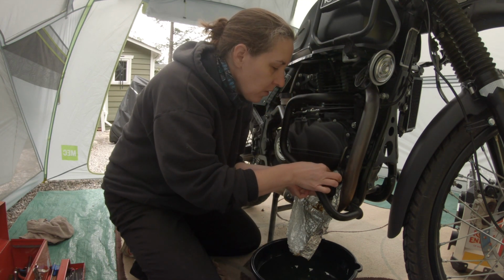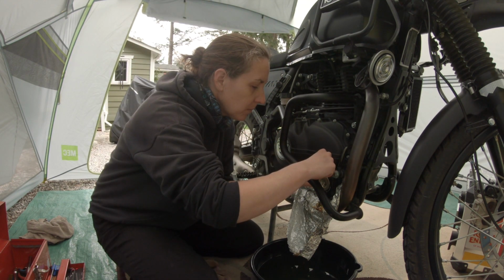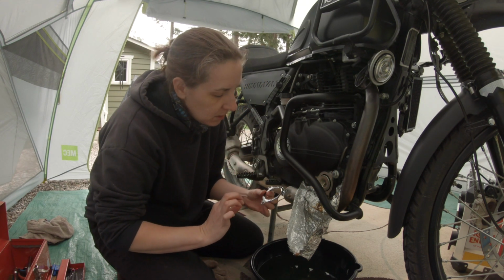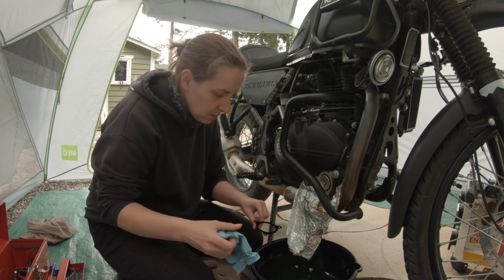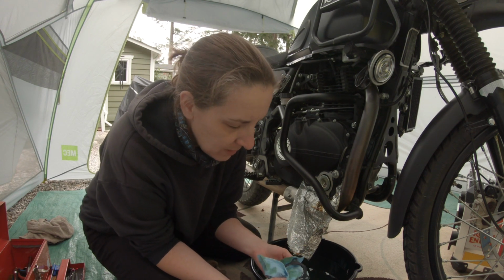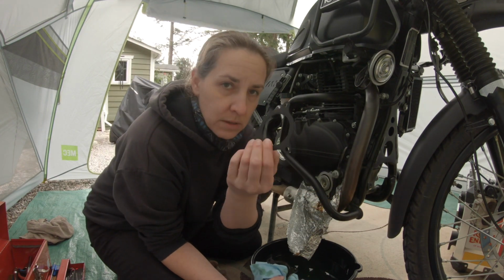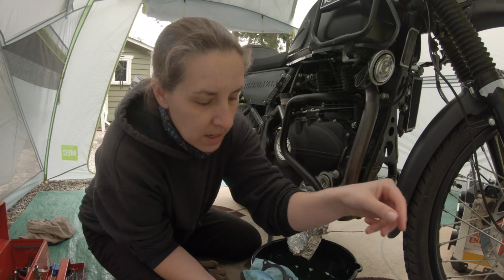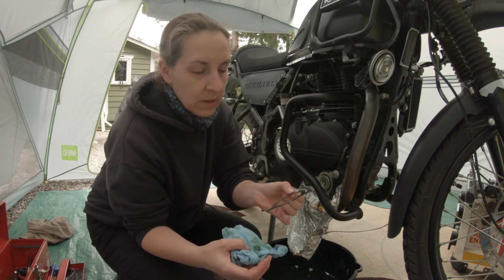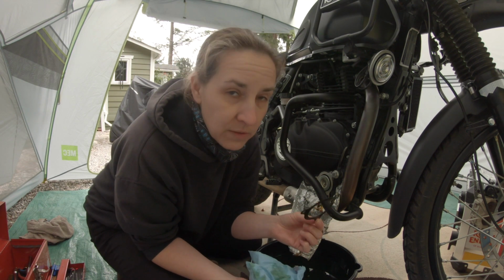Okay. Do have a gasket here. It doesn't look too bad, you know. I always feel bad throwing these out because they don't look that bad, but the new ones, you can't see it, but they're nice and flat. Whereas one that's been used, you can see the indent, the pressure. So it's not going to seal properly ever again, really. I mean, you know, if you had to, that's all you had, I guess.